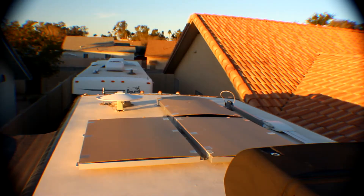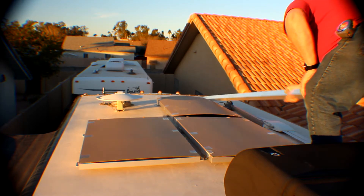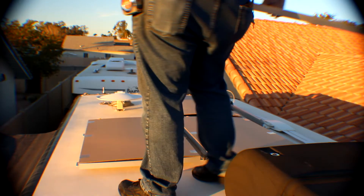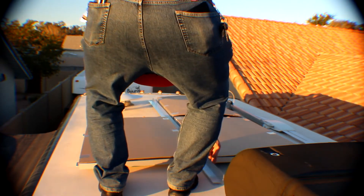After drilling some pilot holes trying to locate the aluminum roof ribs and screw the zippy feet into them, it just wasn't working, so a different mounting plan was needed. We decided that an inch-and-a-quarter aluminum angle, glued to the roof and screwed into the ribs we did locate, would be better. Then we could mount the zippy feet to the angle, which would also allow us to remove them at a later date if needed.